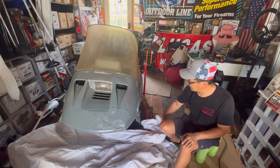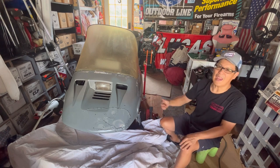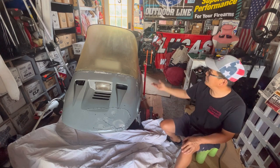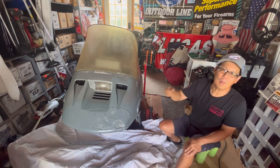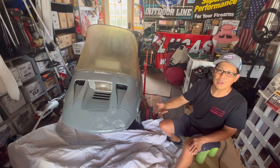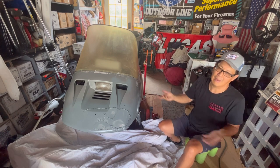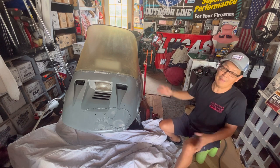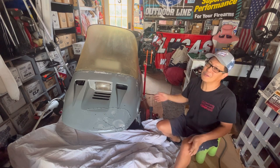As you guys know, we also fixed my steering for the skis. So the next thing I gotta do is, A, fix the fuel delivery system. I've got like 3 big holes in the gas tank. I'm trying to plug those up. Then get a primer mechanism so I can prime the mixed fuel through into the carburetor and so that it starts easily. Right now it's like impossible to pull. You got to pull like 30 times for it to start. So the primer system is messed up. So I got to fix that. And then, two, we just got to wait for some snow. We're in the heart of summer right now, so I've got some time.